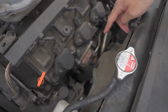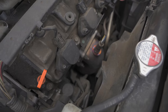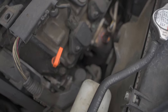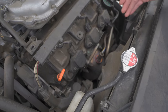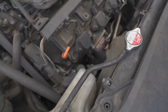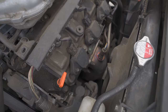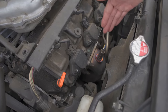Right here you can see I have modified the primary slash pre-cats. I have a high-flow pre-cat from RV6, which is not quite as unrestricted as the pre-cat deletes, but I highly recommend it. This is definitely one of the most restricted areas. When talking about modifying exhaust or emissions, you're going to want to mess with the cats — I know it's technically illegal in California — but that's where you're going to find most of your gains. The pre-cats alone give about 8 to 10 wheel horsepower and 8 to 12 wheel torque based on their dyno sheets.